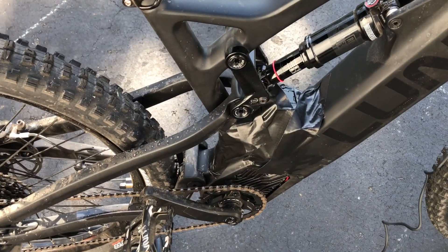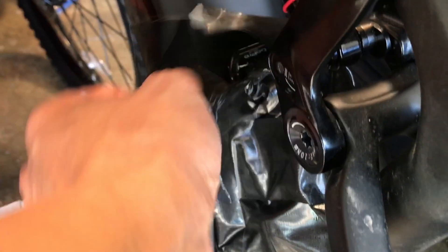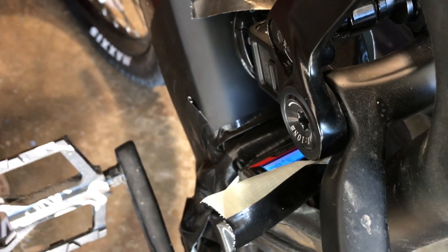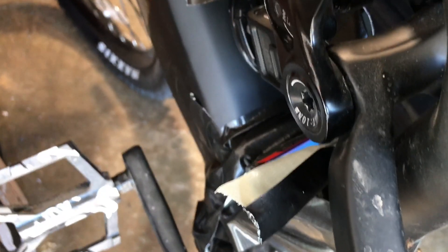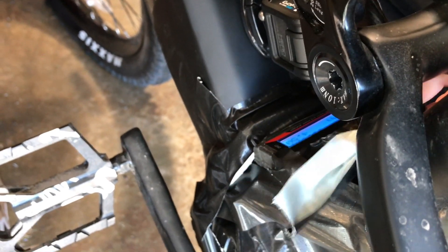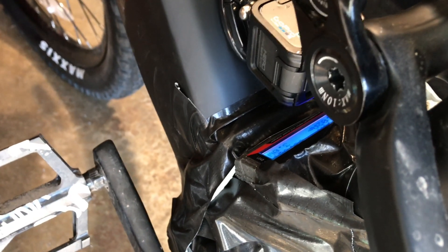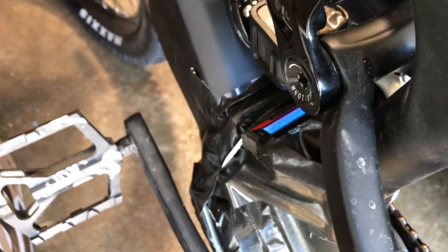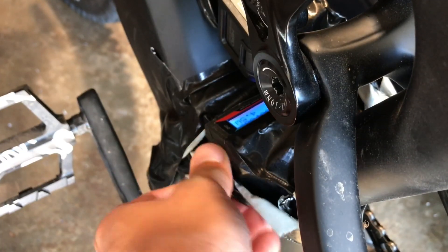I'll try to explain what I'm doing while I'm riding. One thing I should mention: the wires on my power meter aren't the thickest I could use. I should probably rewire this using 12 gauge or even 10 gauge wire to minimize losses. So don't treat these numbers as set in stone — the battery wasn't fully charged, and thicker wires would reduce voltage sag. Keep that in mind as you watch. Let's unplug the battery charger and see what happens.